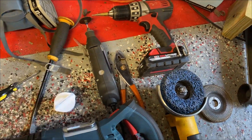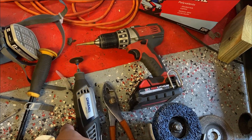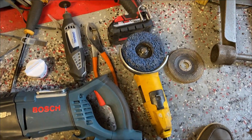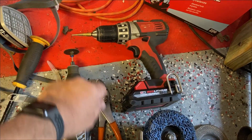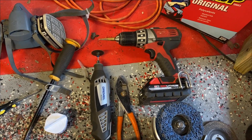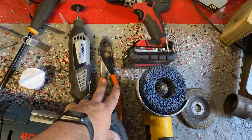You can get this stuff from Harbor Freight. If you need to cut into the welds, I use a dremel — it's a lot better than a cutting wheel on a grinder because it's kind of hard to control. I use this pyramid bit to remove the spot welds. I tried to use a spot weld cutter in the past and it doesn't really work that great. This seems a lot easier and quicker. I also use pliers just to pull the sheet metal back.